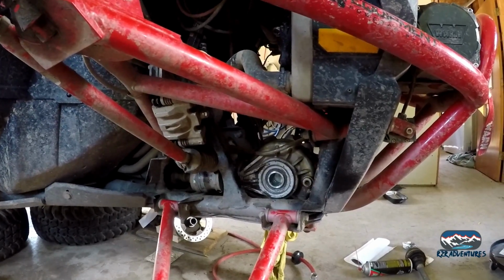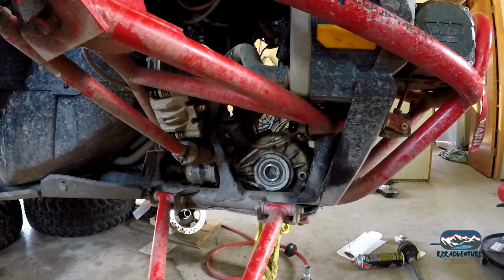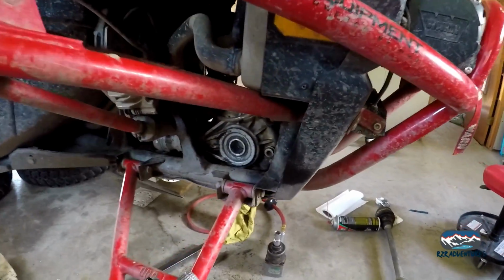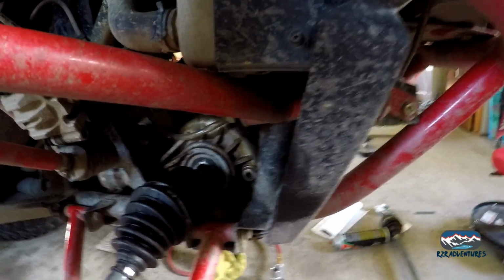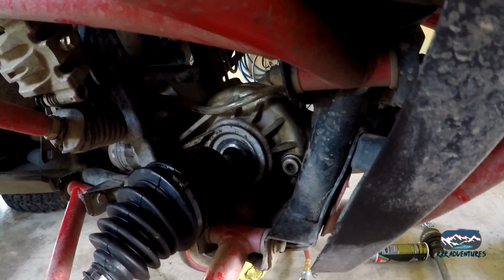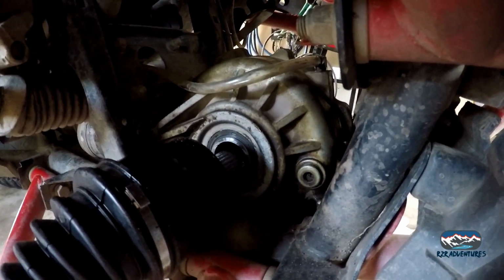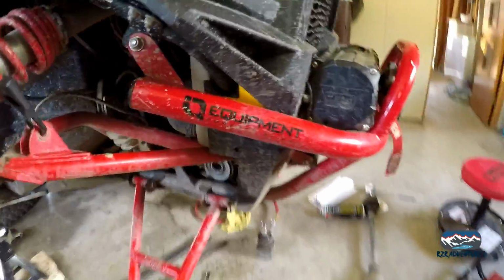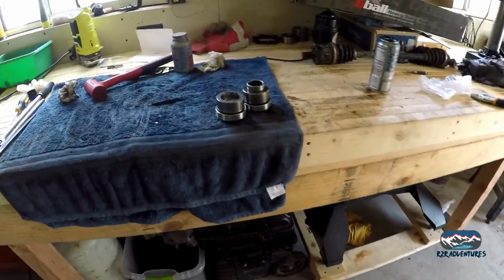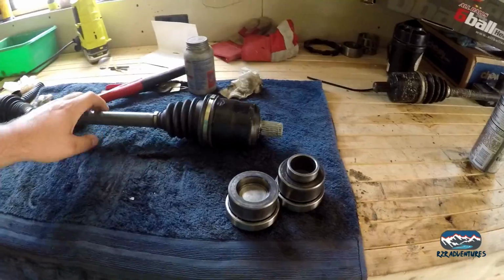The first one that sparks my mind is the 100 horsepower difference. And in a turbo, compared to a 900, you've got bigger axles. So if you can see what I'm seeing here, you can see an output hub considerably larger than the axle. And of course we didn't figure this one out until we started putting things back together. So that's going to require some work here.